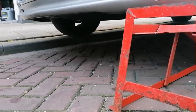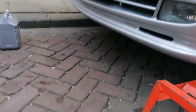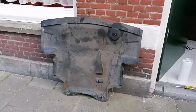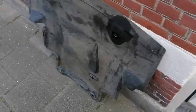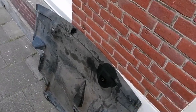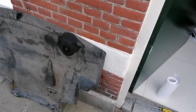I'll get under there and unscrew the protection plastic plate and the sump plug to drain the oil out. You can see these four screws — they come from straight underneath. There's this little protection plate which is there for aerodynamics, debris, stones, and rust protection. It's actually not a bad idea but it's a pain to remove, and it blocks access to my sump plug.